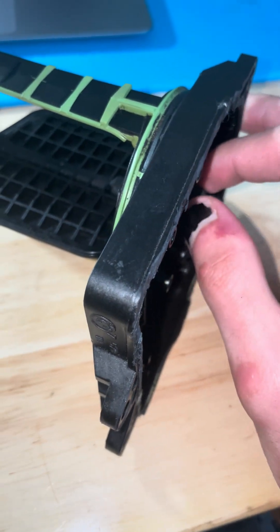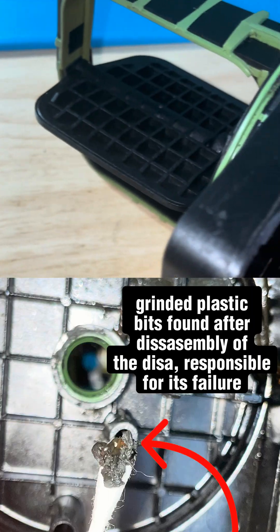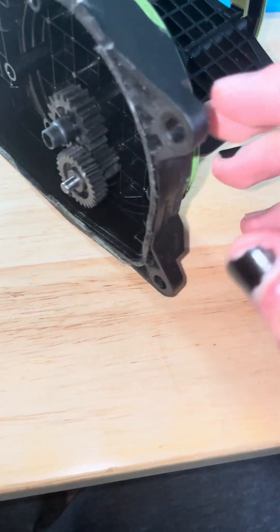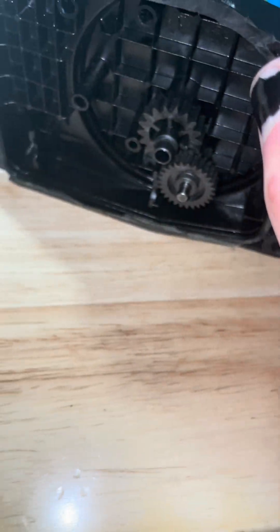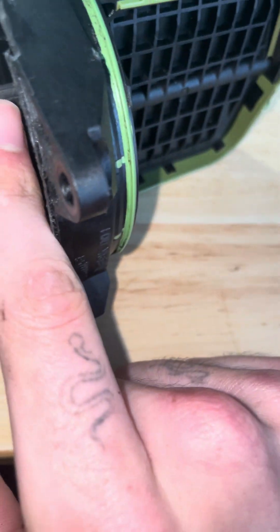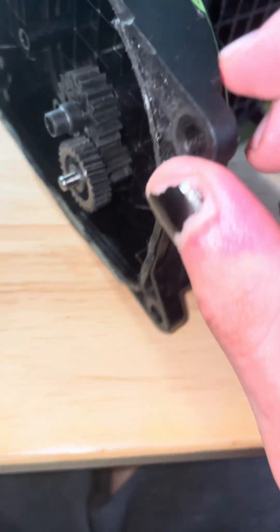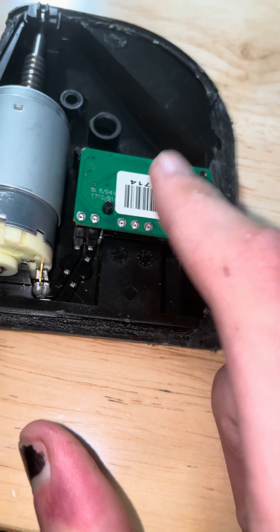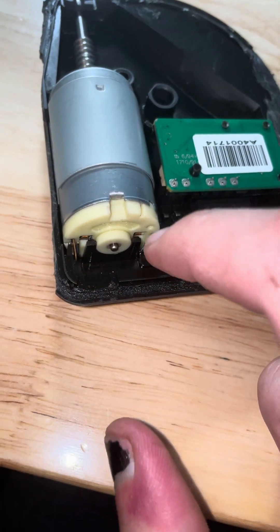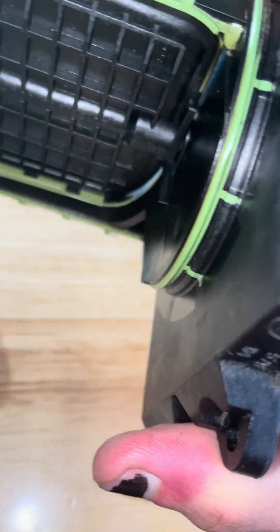The issue is only the singular gear, which doesn't grip enough on the flap, and therefore the flap stays open — that's what causes the DISA to fail. I could epoxy or JB Weld the gear to the flap, but I don't think it'd be worth it. I might do it just to get it moving again, and I might connect something to it — I'm not sure if it's 12 volt — just to get it to function on the bench but not in the car.